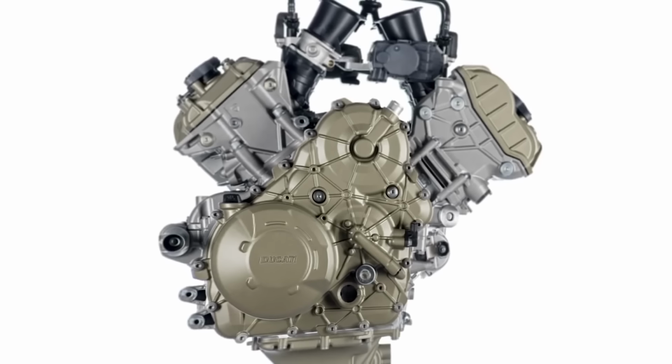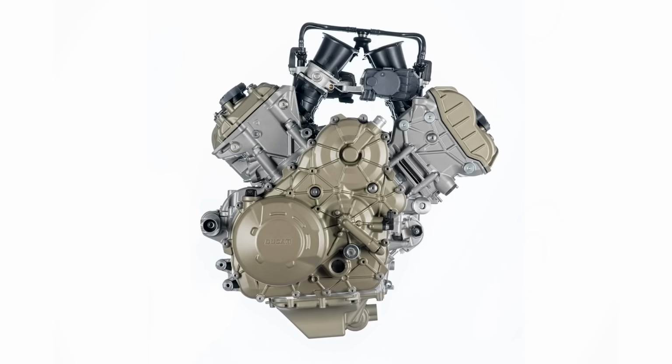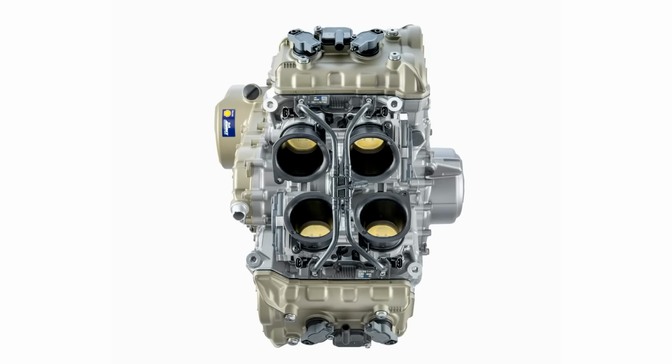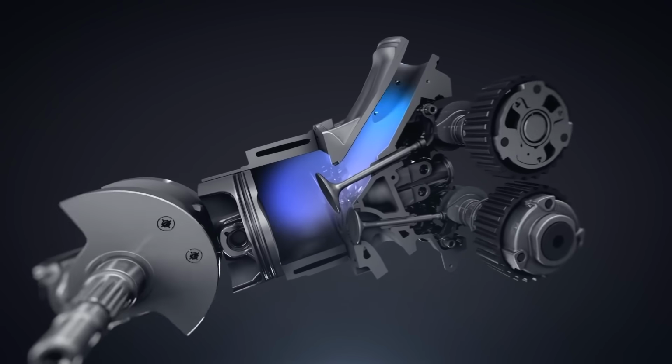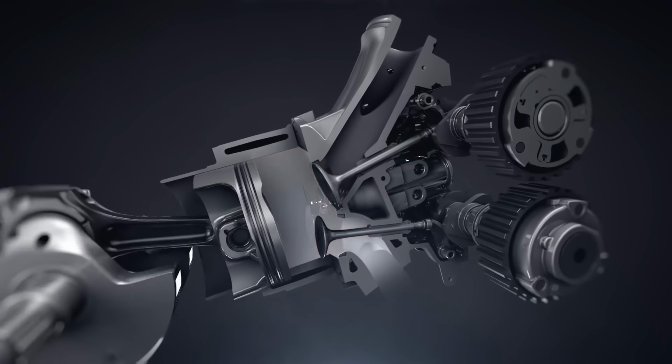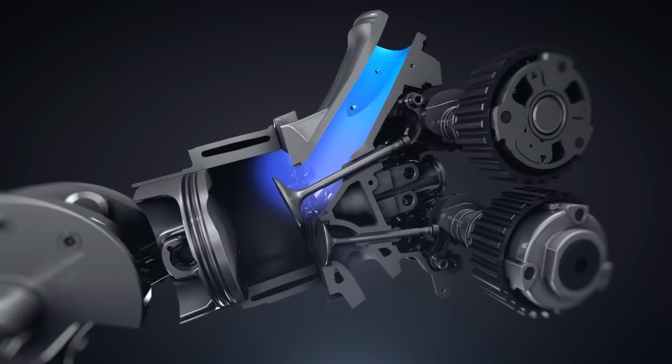Yeah, still too small. Remember, Jay, we were talking about the Panigale V4 engine before, right? If you took the size of their throttle body and made it proportional to our displacement, that means we'd need to use something like an 80 millimeter throttle body. But that's an engine with low piston speed. It's a 40-something millimeter stroke. And we've got this ridiculous piston speed. So the interesting thing with all of these theories is what changes when you're at 7,400 feet per minute, as opposed to F1 engines at something like 5,500 feet per minute.